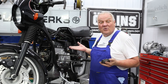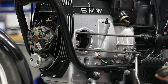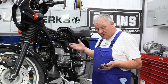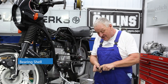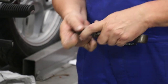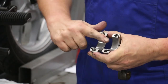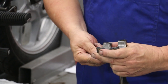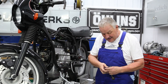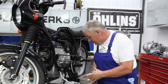If you've been watching along, you know the boys here took the block apart and replaced the main bearings. What we're going to do now is replace the rod bearings. I still have the rods from when I took it apart — I labeled everything left to right. These bearings really don't look bad; they've got no abnormal wear. But since we've got new bearings and new everything else, might as well put some new ones in as well.